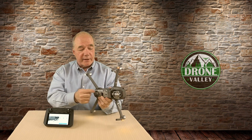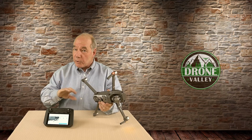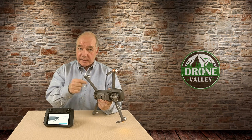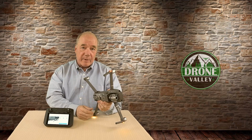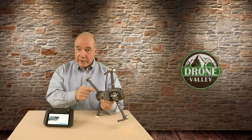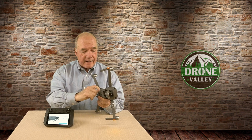Now, I have to caution you, that button looks like you should be pushing it with a pen, but if you're a fan of the channel, you know I've done an entire clip on how you can easily break your quad by pushing too hard on that button, because there's nothing behind it and it's going to pop off the printed circuit board. So the only thing you want to push that button with is your big fat finger. So use your finger, tap that button.